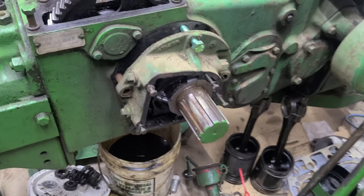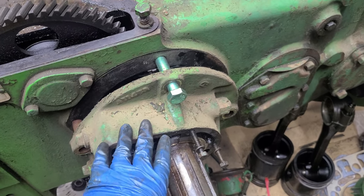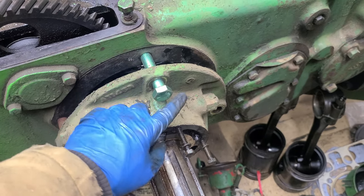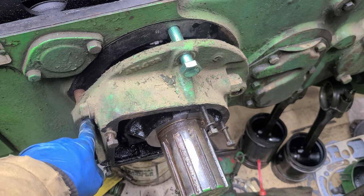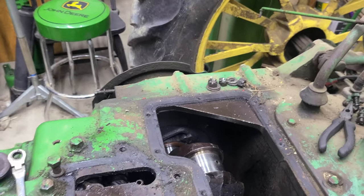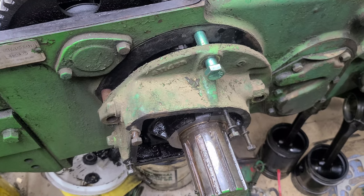Good news — with the crank still in the main bearing on that side, I needed to draw this off straight but the bolts were too short, so I got a longer bolt. It's kind of resting on the stud here, and just like that I was able to get the pulley off. I believe this crank is now ready to come out.